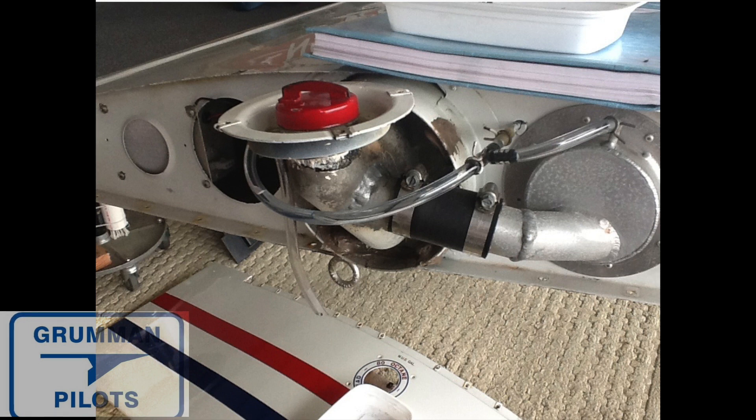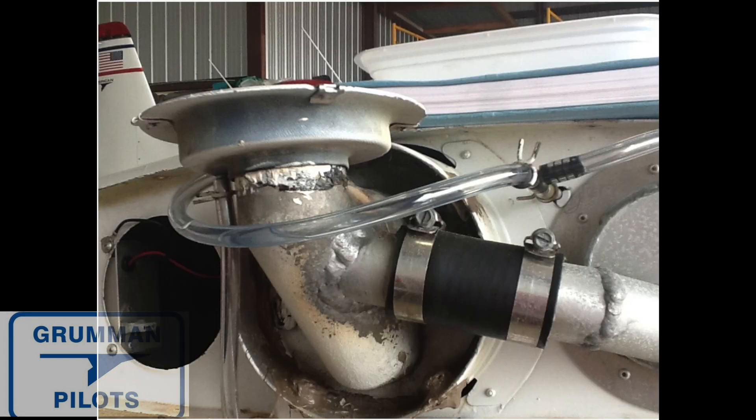Let's talk a little bit about filling the early single-cap system. When you fill the main tank, you try to direct some of the fuel into the aux tank, but it's not until the main tank gets really full that you have to slow your rate of feed down to get fuel into the aux tank.